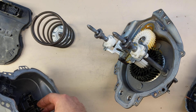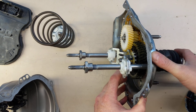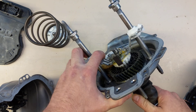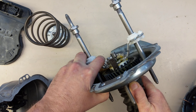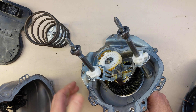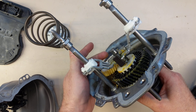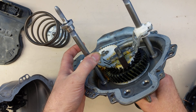This is the outer cover. Basically, as you would put torque on this and the master cylinder would start fighting you, you would activate the torque sensor, which would press that out. The ECU would sense it and then spin the motor, thus helping you press. And then when you take your foot off, the spring would push it all back.